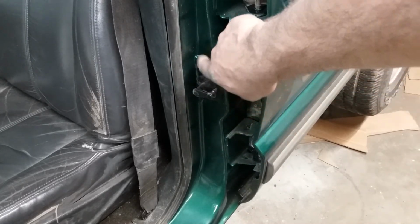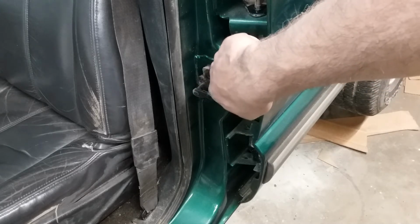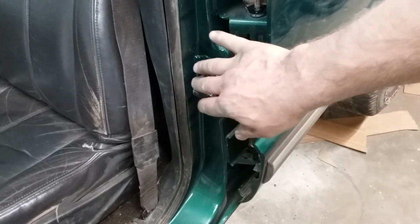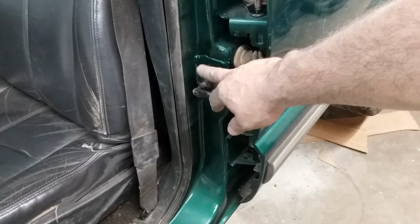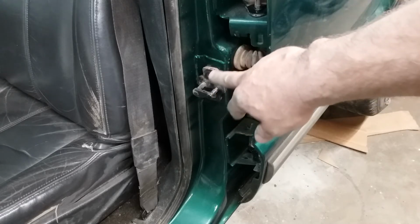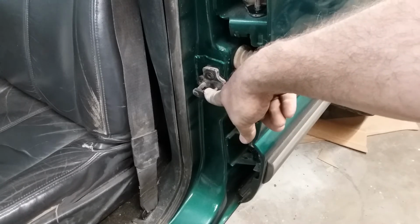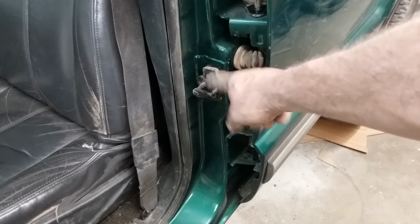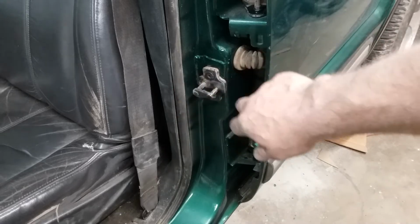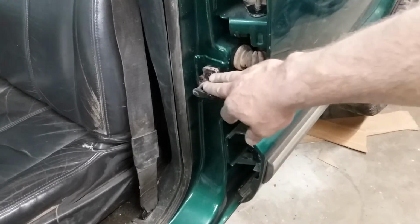But you can see here I've welded in a piece of 3/16. I welded it in, ground it kind of flush and flat, and it is a little bit touchy when you're doing this repair because you don't know exactly how much everything's been tweaked and whacked. The door closes great, but it is kind of touchy when you're trying to get the holes lined up right to drill the holes. There's nothing that I can find to measure to. I just kind of use the WAG system.